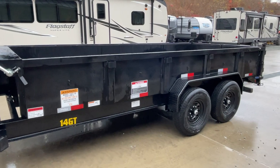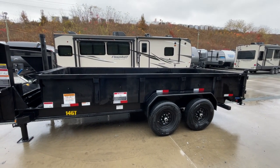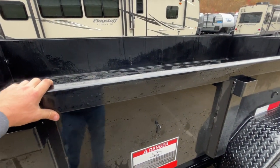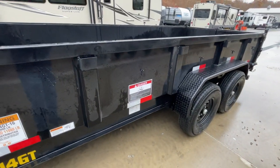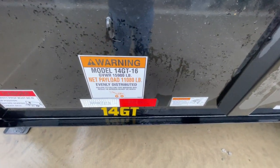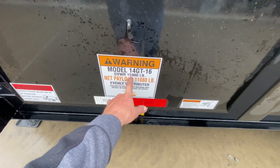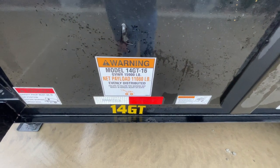This unit does have two-foot sides, as do most 14,000-pound dumps in the industry. We do see some that only do a 20-inch side, but this is two-foot. It also has a two-by-three tube top rail — a lot of times you'll see a formed top rail, but this is actually boxed-out two-by-three tube. Stake pockets if you want to build your sides up, with reinforcements right under your stake pockets. I generally go by the axle ratings — two sevens is 14 — then I count about 3,000 pounds of tongue weight, which really is 17. Here they're rating this at 15.9, which includes your 1,900 pounds of tongue weight, and then minus the roughly 5,000-pound empty weight gets you the 11,000-pound payload.